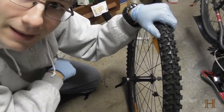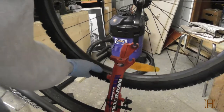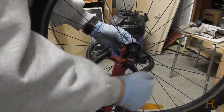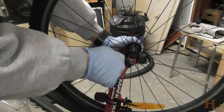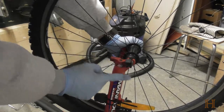Time to mount this bad boy back to your bike. Mounting it to your bike is simple — it's just the exact opposite as before. As it is a quick connect and disconnect, slide it into the forks. Use the little handle here. Start tightening it up, and bring it back — straight back a bit — because you want this to point in a direction where you can actually grab it again. And close it up.